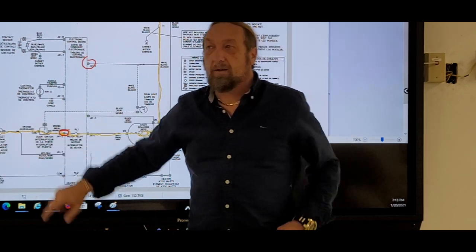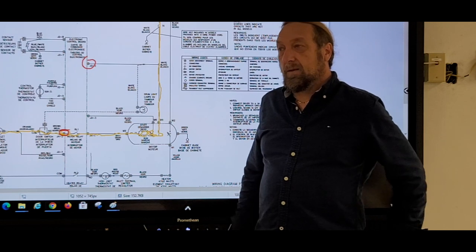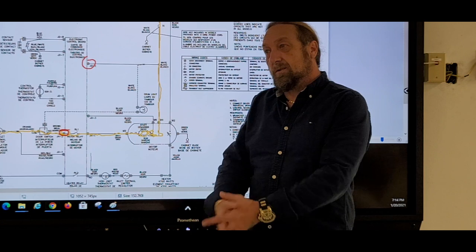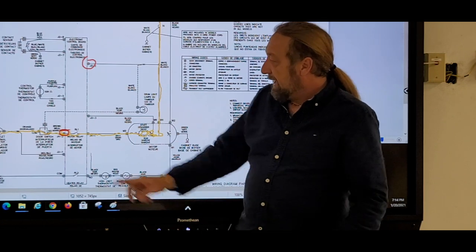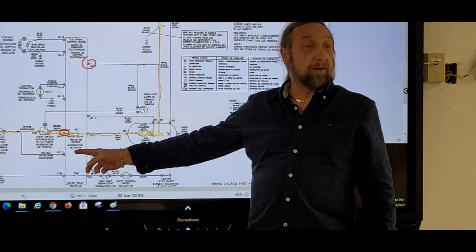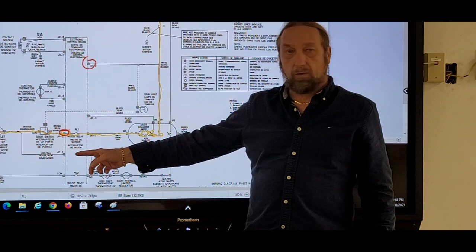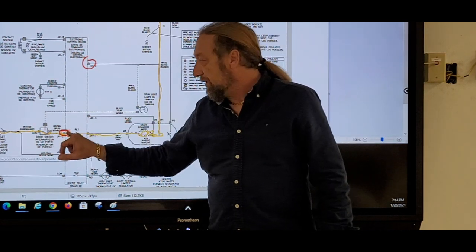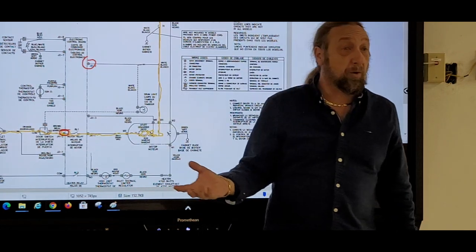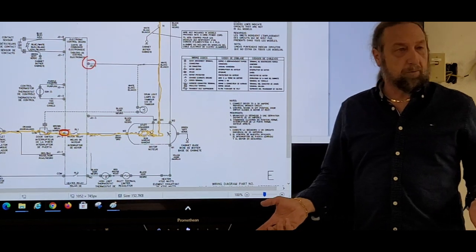you? What if you don't check the door switch from the control board? You could go down to the switch itself and check the switch. Okay, so if you don't have voltage here, we already know we have voltage here because the board's lighting up and you have to have voltage here for the board to light up. Okay, so I already know if I don't have voltage here, the only thing from there to there is that door switch and a couple of wires. Again, wires do break, but they're not very common to break.